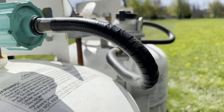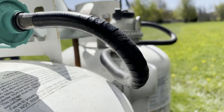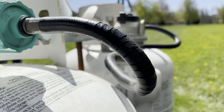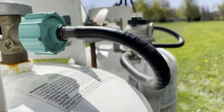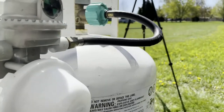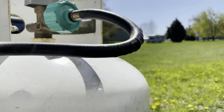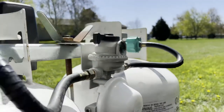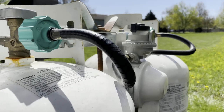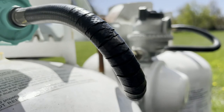So we know we have full propane because I filled these up a couple weeks ago, and last night we could hear and smell propane. What I've noticed is these are cracked, and when you move them around you can hear the change in sound. These are the original lines we've had on the camper for the past couple years — they didn't used to have a cover on them, now we do, but apparently that's what the sun will do to them. We're gonna swap these out and see what happens.